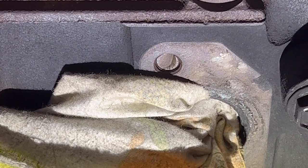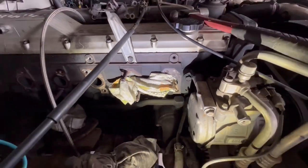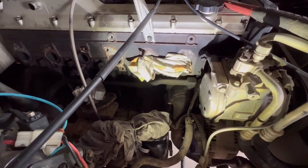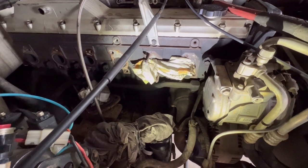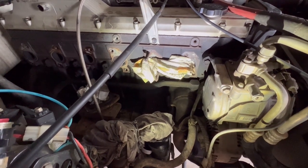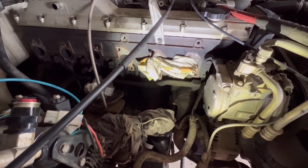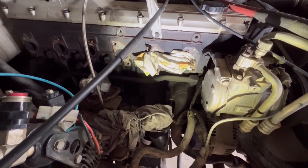Time to tackle this broken stud in the Troopy. We've got a replacement exhaust manifold now. I just need to get this drilled out, then I'll re-tap all the threads, clean them out, hopefully get it back together. First things first, get rid of this dirty stud. I'm working under torchlight. I've got no power in this shed yet, unfortunately. There you get that.